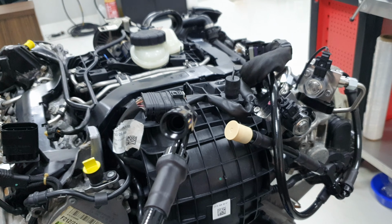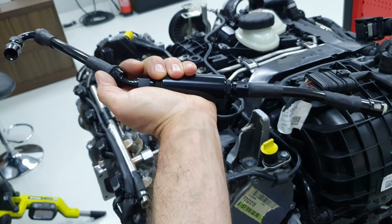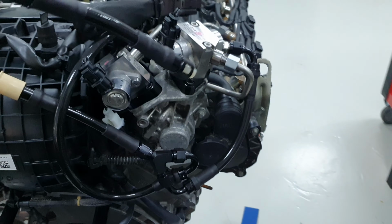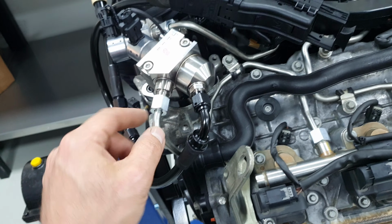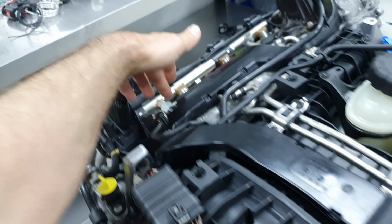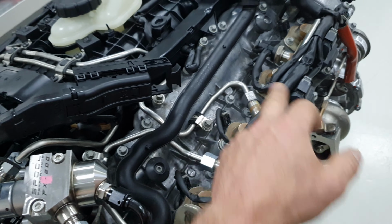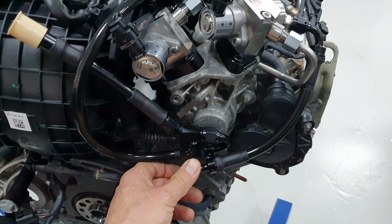This goes to the body of the car, where the steel fuel line is, and it's supposed to come here. Again, I routed it this way. I don't have any instructions for the fuel system. I put the steel lines, the aftermarket ones, to match the high pressure pumps. The same thing from this side, this one all the way here, and this one all the way here, and the loop is the same. That's looping both rails.